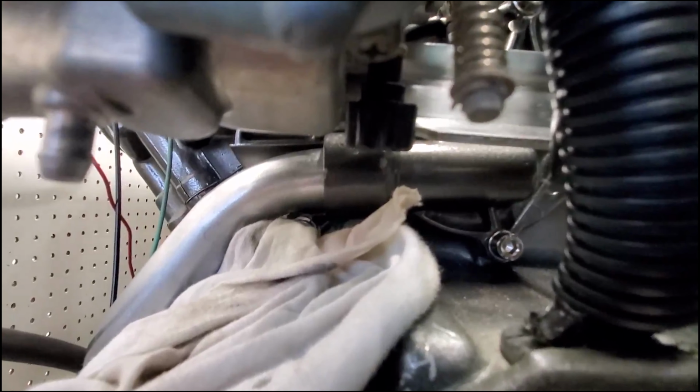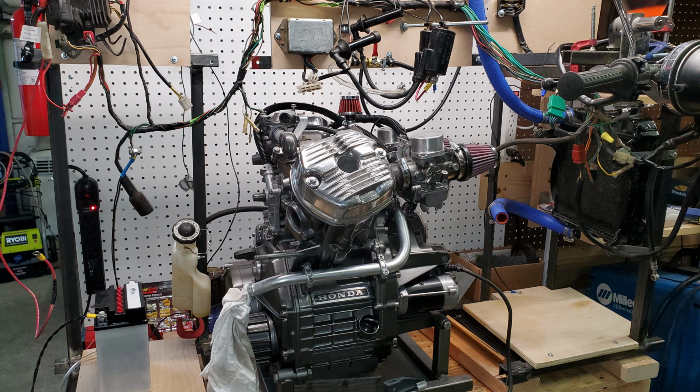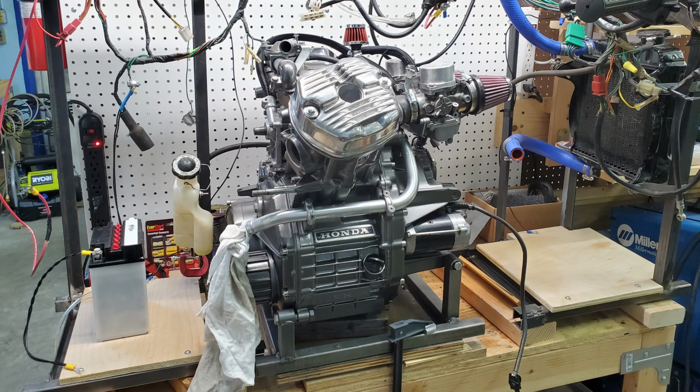So with that, I can add the coolant to the engine. After I added the coolant, though, I immediately noticed a small leak in one of the coolant pipes. You can see it here above the white cloth where the silver pipe enters the engine. Finding and easily troubleshooting issues like this, though, is the whole reason I built this test stand. But I wasn't as clever as I thought I was, since actually accessing the backside of the engine requires draining and disconnecting everything and rotating the engine around on the Lazy Susan.